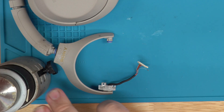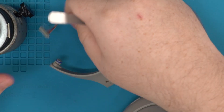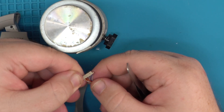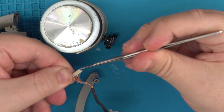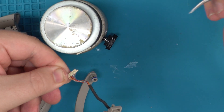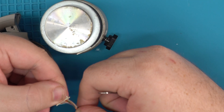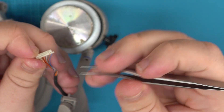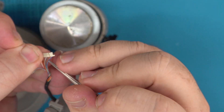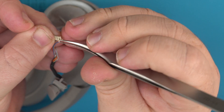You want to put a little pressure but not too much — just enough where you feel like you can't move it. Now we'll be going color for color. You want to make sure your pin is faced the same way, and you want to start off with one side so it goes one to one. If you feel like you might mess up or get confused, use your phone — take a couple photos of all the colors, because a couple of these colors are very similar. Just one's glossy, one's matte, but it's harder to tell. So this one is position number three, but we want to get position one — the blue one — out first. Grab your little tweezers and go underneath and pull that off.